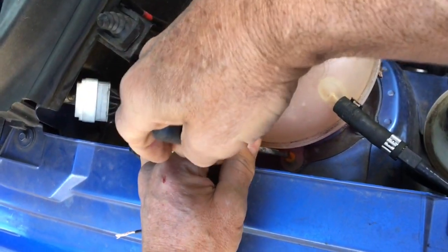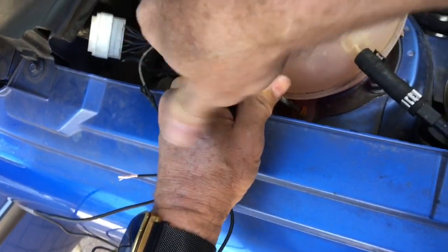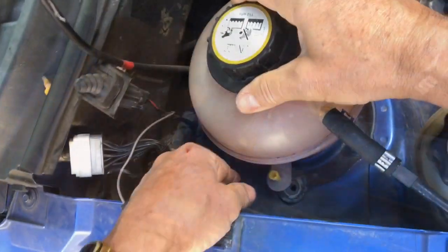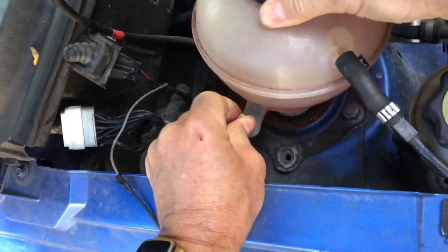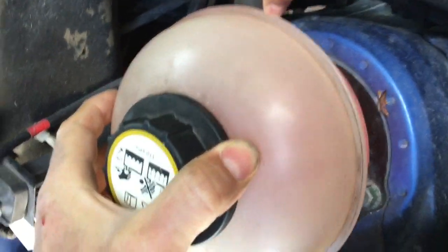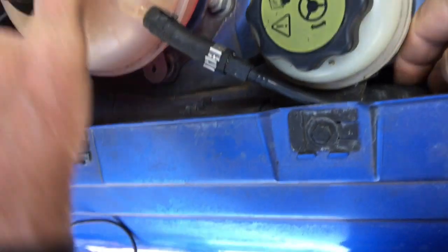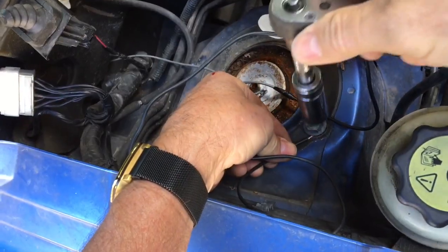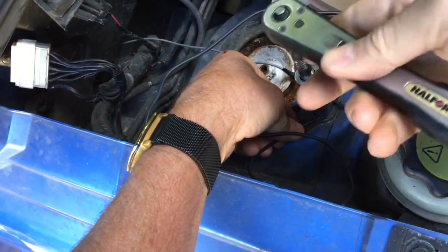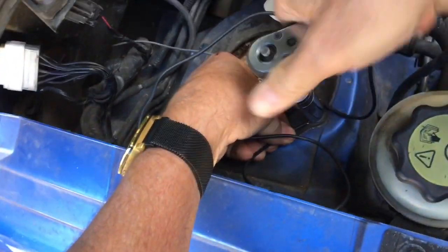At the same time I'm going to disconnect the tank. There's a nut here — undo it and that pulls up. I'll release the tank from some of these clips to give a bit more room to work with. Squash the wire underneath the nut — it's about a 15mm nut — and do it back up with the cable underneath it.